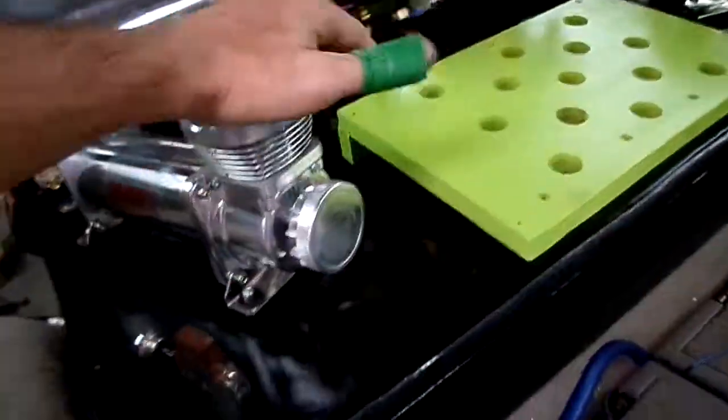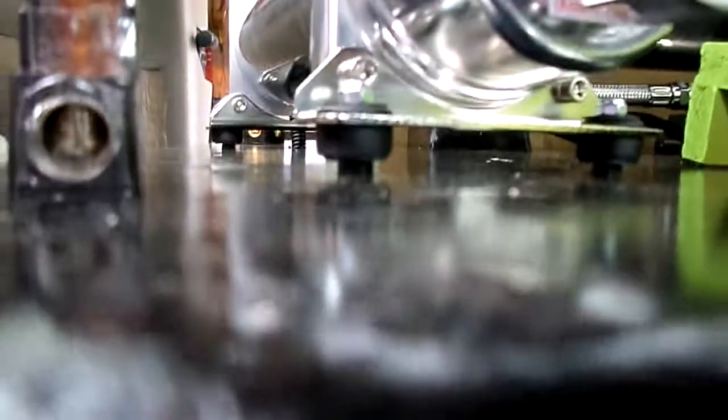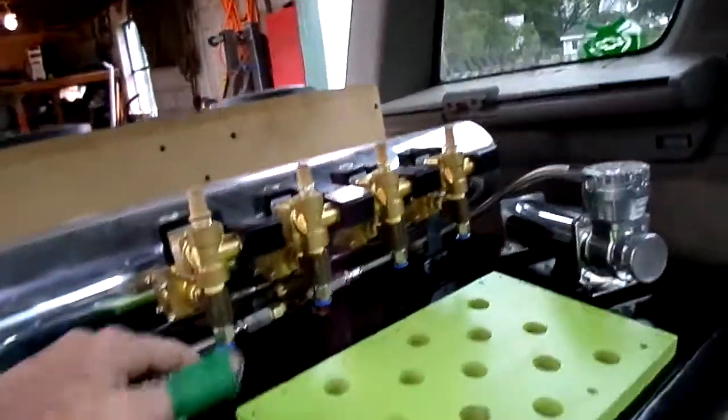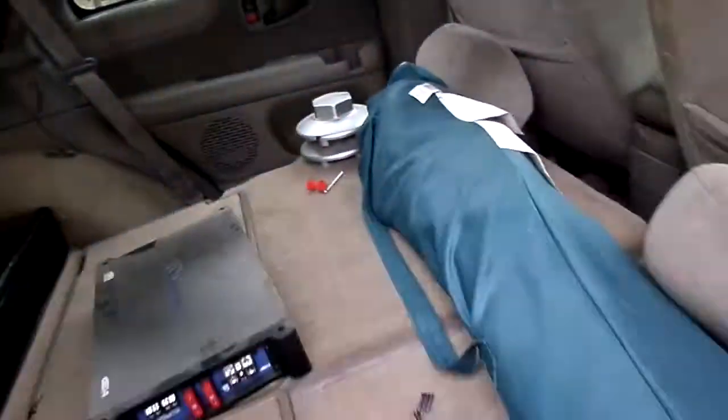I'm going to take a small drill bit through here, then when I take it out I can drill through the other way — I'll just be real careful. I drilled these holes already, you can't even tell because I sprayed over it, it turned out pretty good. These are mounted snug. The way I mounted these, I took bolts up through and then took the original nut on the bottom to tighten it up — it holds that, then I can take this on and off and leave the studs in there. I made them like studs, and it keeps it up a little more. The only thing rubbing on the paint is that little teeny nut, but she's getting there.